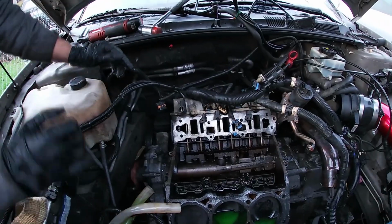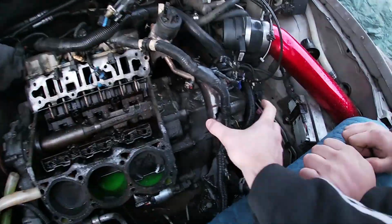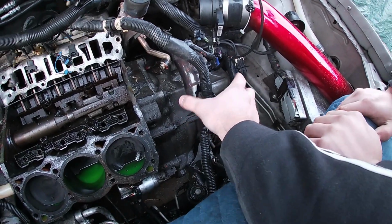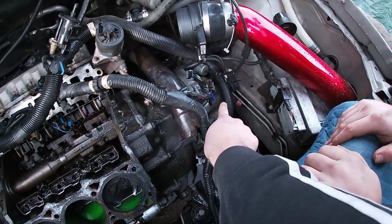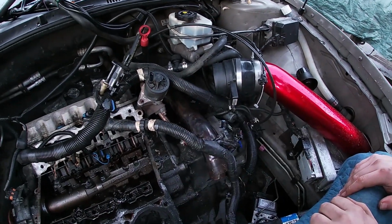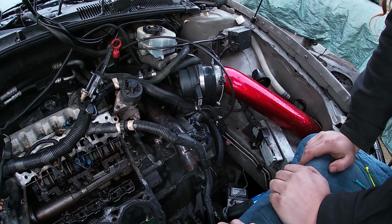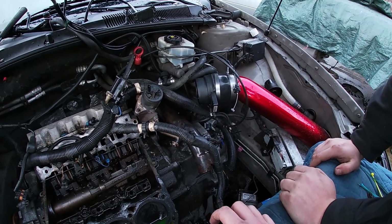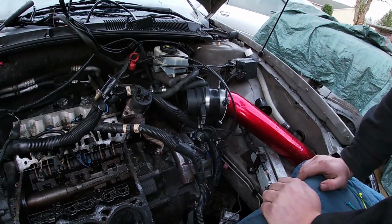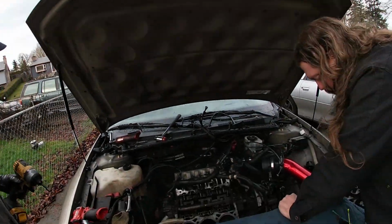Doing some transmission parts is pretty tempting. Yeah, it is. You can buy an input shaft that makes it significantly stronger. And while you're doing that, there's a sprocket on this side, and where it goes to the other side for the actual delivery of power, it's chain driven, so that's a big weak spot. You can buy different sprockets and a one-piece chain, or just a stronger V8 chain from like the LS4s. The V8 chain's only slightly stronger, and it's barely enough.